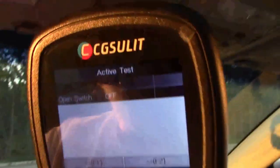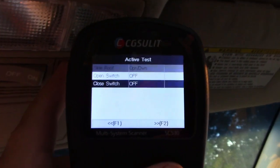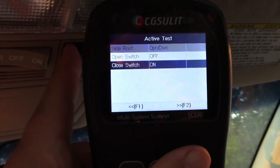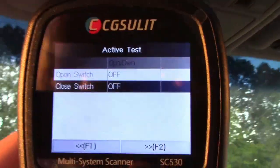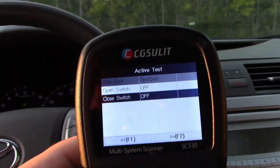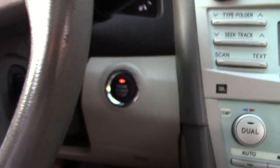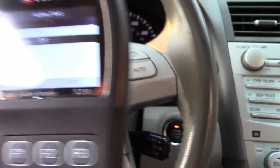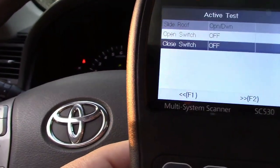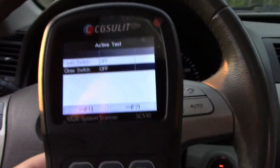We can do more. This is for the sunroof — this is to open the sunroof. By pressing the button here, it'll tip it up and down. It'll also tell you the close switch if you need to close it. So you can test switches, you can activate motors and actuators. Earlier it said engine starter relay — this is a push button start vehicle, and I guarantee you if I had hit that, the engine would have started from the scan tool. You have limitless abilities with this scan tool.